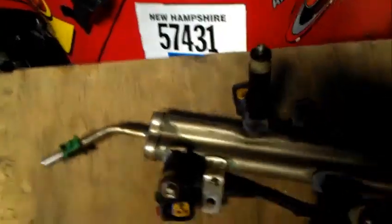Here we are in the motor. On the top I've taken off the intake, which is this part here. I've disconnected the connections, which is two plugs and a tube, and the throttle cables. On the back there were two tubes and a map sensor. We had to take out the fuel rail, which goes across the middle, and the injectors had a connector here and one here.